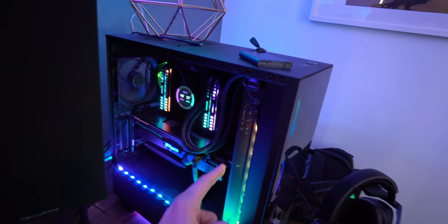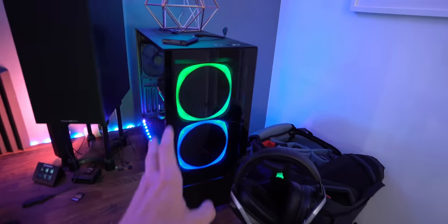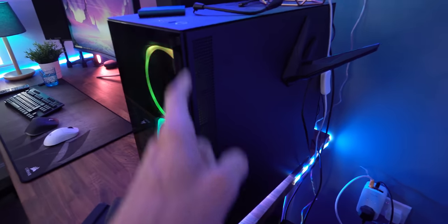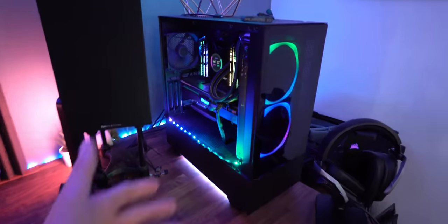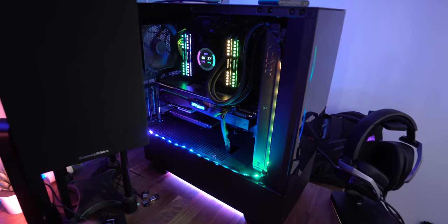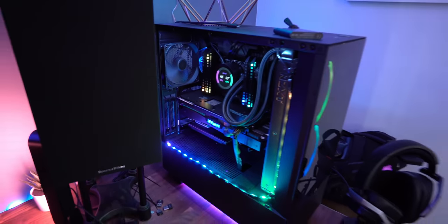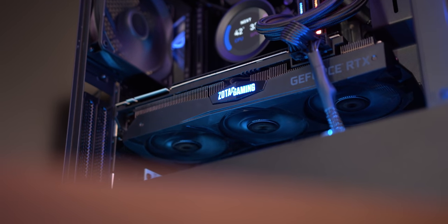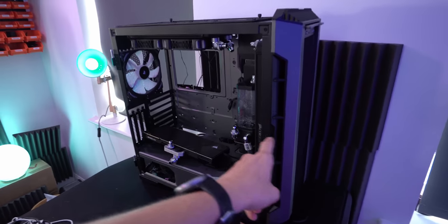We've got this 280 millimeter radiator at the front, and this is pretty much why I want to update everything — because while it looks incredible, airflow on this thing is okay. It's not bad but it's not really good enough for what I've been using it for. I've actually got the side panel off just because it's been overheating. I don't know what it is about that Zotac graphics card — I have a feeling I need to take it apart and see if something is actually wrong with it, because unless you put a specific fan profile on it, it hits 85 degrees and then shuts down, which is pretty useless. That's why we are going to be doing a little bit of a case swap.